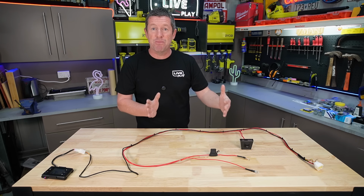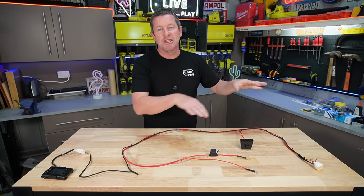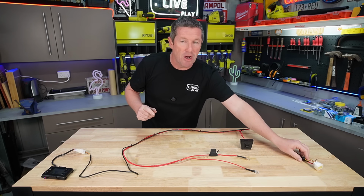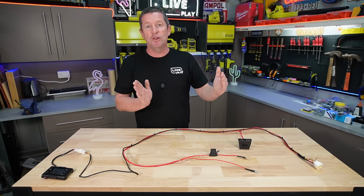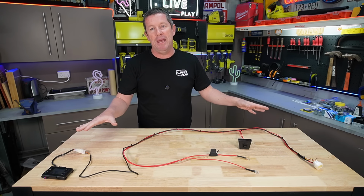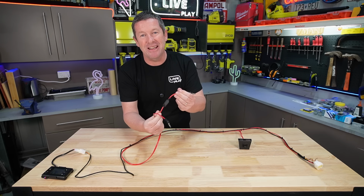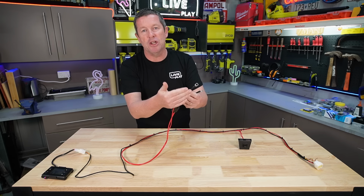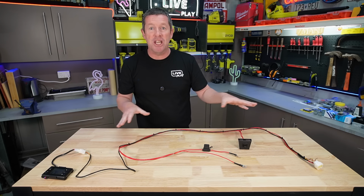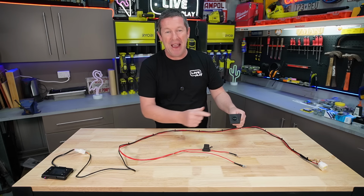Now in our case, because we're in close proximity to the battery, we actually had to cut the harness down a little bit just to keep it all nice and tidy. You could just maneuver it around, but in my case, I had an issue where the negative lead that comes off the plug that goes into the heater itself was too short and wouldn't reach the battery anyway. So what I've done is I've created a little bit of a mini loom here, which is a really good idea. I've just tidied it all up and I've upgraded the wiring in doing that. I had a slightly better fuse holder, so I've added that in. And obviously proper terminals that can go onto the battery, I've heat shrunk them all on and kept it all nice and tidy. I've then worked out where I'm going to run the loom and started stitching it all together around to an area where I've also added in a switch.